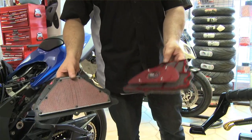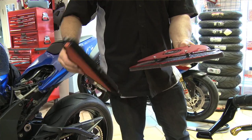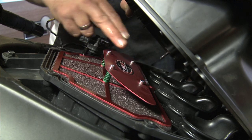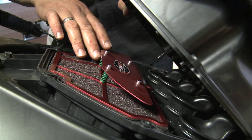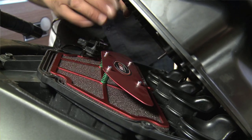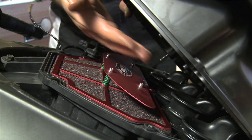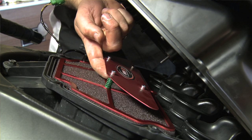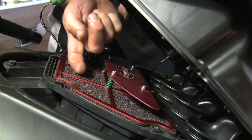The filter has a unique feature — it looks almost like a spoiler. What it actually has is a deflector plate. That deflector plate not only works as a baffle plate for the dB level of the machine on an open circuit, but also deflects the air so the airflow works with the fuel and the injector, rather than a standard filter where the airflow will actually blow the fuel away between the injector and the bell mouth. So you'll consequently gain more power through that air filter.